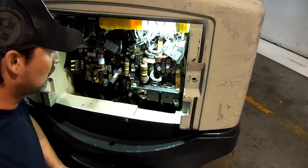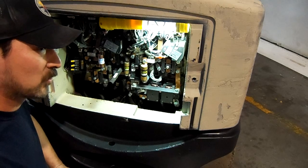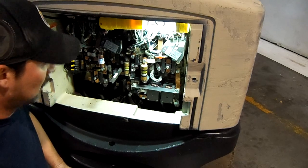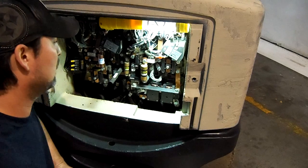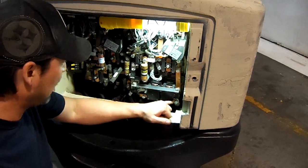Here we are at the back of the truck with the access panel removed. Always remove the battery before doing any work in this panel. First thing you want to do is a visual inspection — you're looking for any burn marks on your cables, any loose bolts. I don't know who did the work prior, but that would be the cause. You're looking for any damage at the tips, anything caught in there that might be contaminants. I like to hit the plungers — if you get lucky something will fall out.